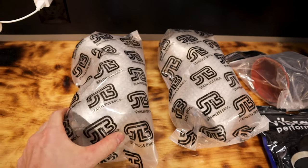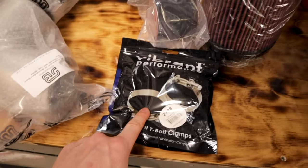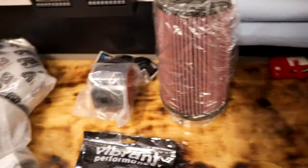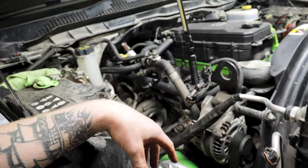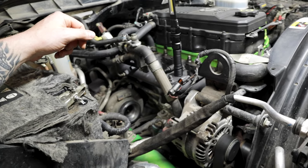I like Air Aid - use whatever one you want. Let me lay these parts out so you can take a look. We ordered a couple of 90s from Stainless Brothers, some clamps from Vibrant, a four-inch boot that goes on the turbo, and our air filter. In theory this is pretty simple to make, but knock on wood. If we look at the stock intake, it's essentially a couple of 90s. The air filter should sit right up in here and we'll bolt a bar across and weld that up for support. Let's jump into it.